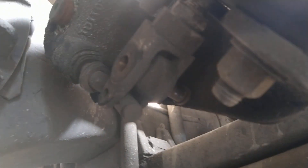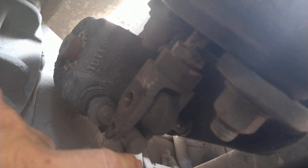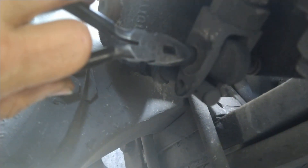So what I had to do: I got the other pin out, backed the brakes way off — you can see the huge gap in here — and I'm gonna have to get someone to try to apply the brake pedal lightly for me while I find wherever my punch went, stick it in this hole, and punch it through there at the same time, and hope that works.